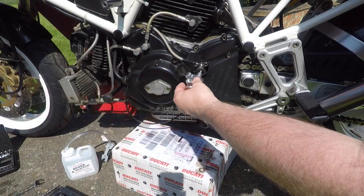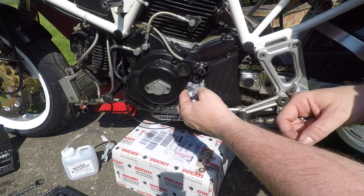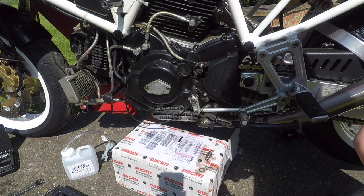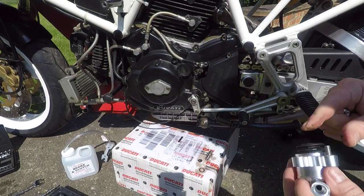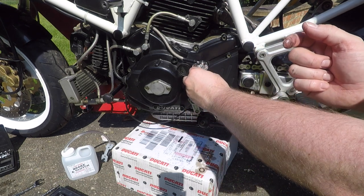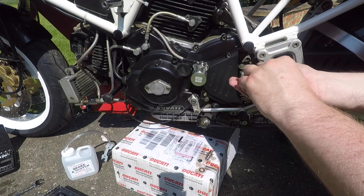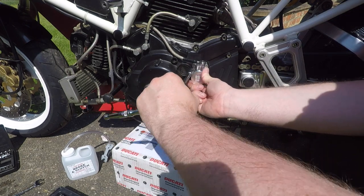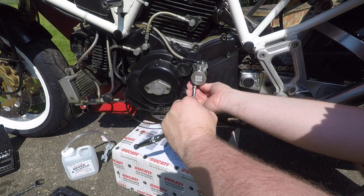Get the old cylinder out of the way and offer up the new part. Don't forget the rubber gasket behind — this needs to be fitted as it will keep any dirt out of the way. Then you can loosely bolt up the new part, and get the opportunity to check whether you've got that spacer in there if it's required, before you go too much further.